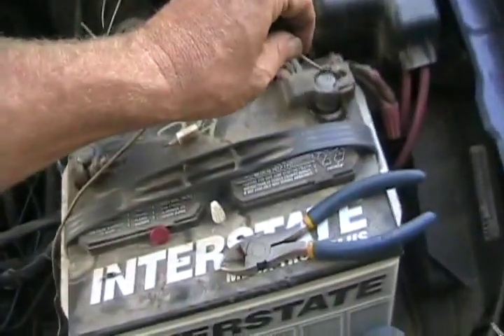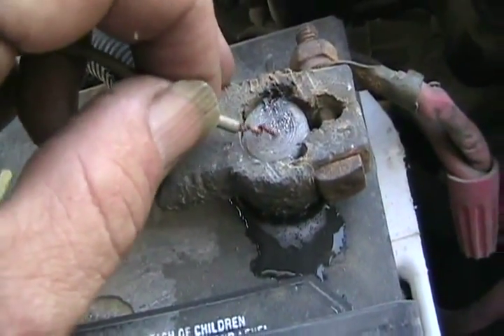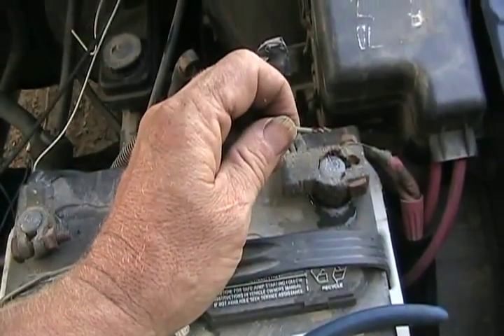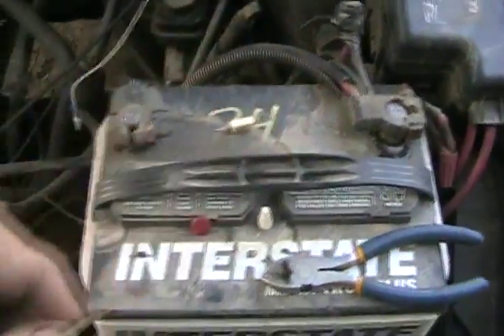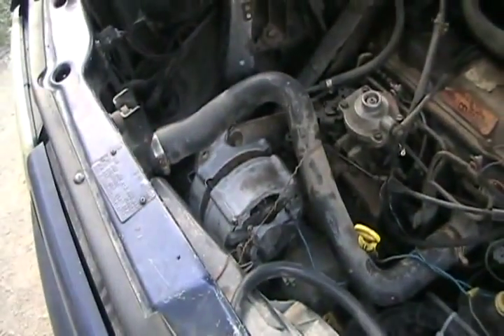You don't need any more power once it's excited, so it would just keep working as long as you drove the vehicle. The next time you go to start it, you have no wipers and it's discharging. So I took that exciter wire and touched it to the positive with the vehicle turned off, and it just makes a tiny spark, which is normal. But when I started the vehicle and touched it there, it makes a huge spark and the wire gets very hot very quick. I measured the voltage — it was like there was power coming out of there — and it measured 6.38 volts. This was trying to put 12 volts into it, and the two voltages were interfering, and that was cooking something.